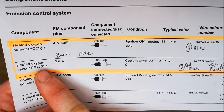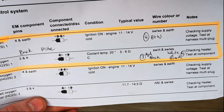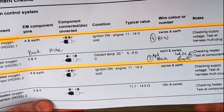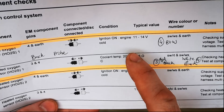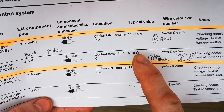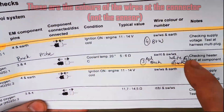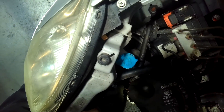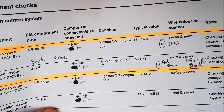The next test is on pins 3 and 4, and it's carried out with the vehicle in the cool-down position. After bringing the vehicle in, I let it sit for quite a while before starting, because you want correct resistance readings. With a coolant temperature of 20 degrees, you would expect to see between 5 and 6 ohms of resistance. The wires are pin 3 (black and red) and pin 4 (black and white). Disconnect the oxygen sensor, then use your multimeter across pins 3 and 4.